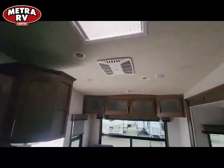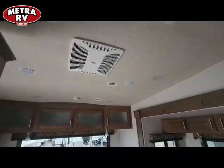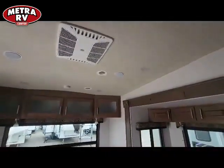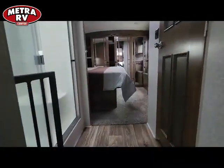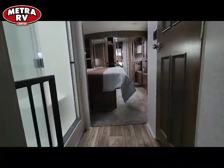You're going to get one single 15,000 BTU AC in this coach. The ceiling material is Ozite, which helps wick out condensation when you're running LP heat, so you don't have to worry about musty smells later when you're not using the coach. You get a 5/8-inch plywood floor and a 7/8-inch bonded plywood roof — it's a fully walkable roof with wood roof trusses to help wick out condensation.